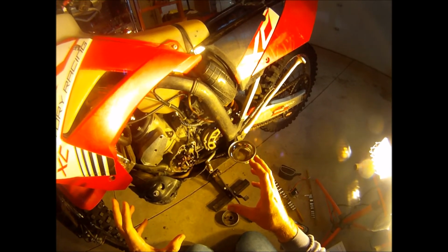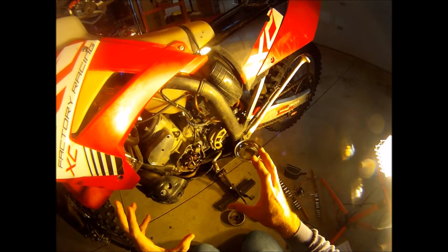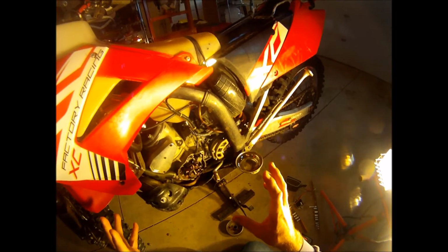So when they say floating the ground, what does that mean exactly? What it means is, if you're going to use a combined AC and DC system on your bike with a full wave rectifier, you can't share the ground. Okay, that's the bottom line. And that's why you have to float the ground here.